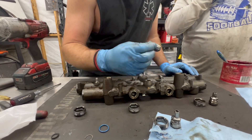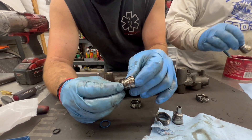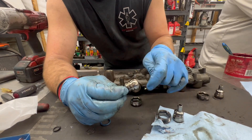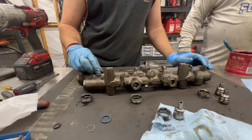These are the HHC Diesel nipple cups. They're not just smooth - they have this extra lip which is supposed to prevent, when this does start leaking, from eroding that upper o-ring. Either that or the upper o-ring was just already worn out.